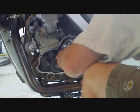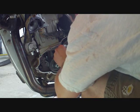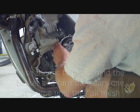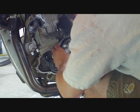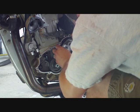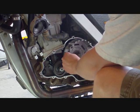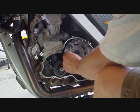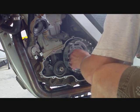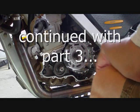Got it synced up with this gear. You will know when you have got it lined up because the basket will just pop right into place. It won't move. You check your gear - it is not turning. The bottom one is not turning either. You can tell it is trying to turn the whole basket, so you know everything is meshed up nice and neat.